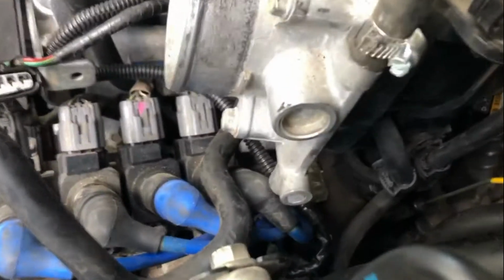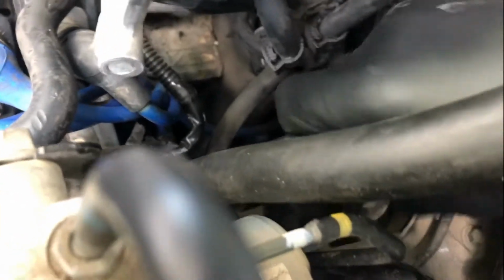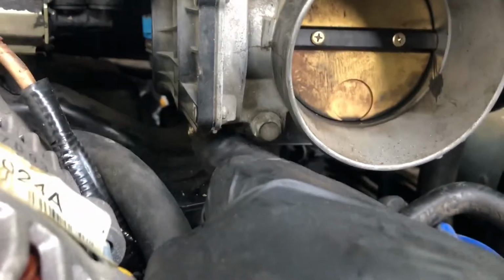and you should have a fuel line right here, so we're going to have to remove that one as well, and that's actually hooked to the fuel line right here. So I'm going to go ahead and disconnect that line as well. I'm going to do that one, and then we'll start removal of the bolts, which are 10mm bolts. And disconnect it, removing that clamp on the bottom end of this throttle body.